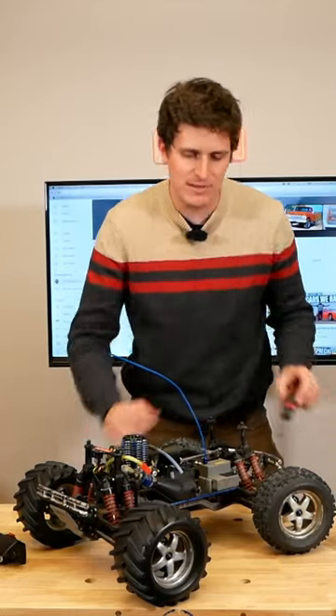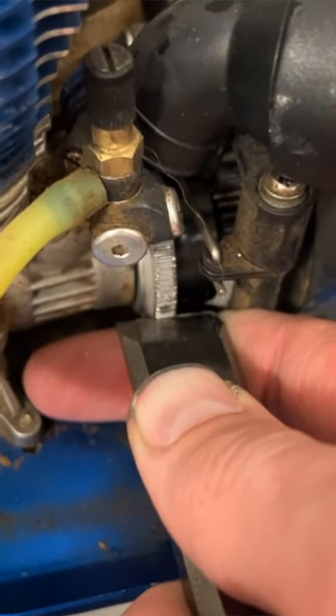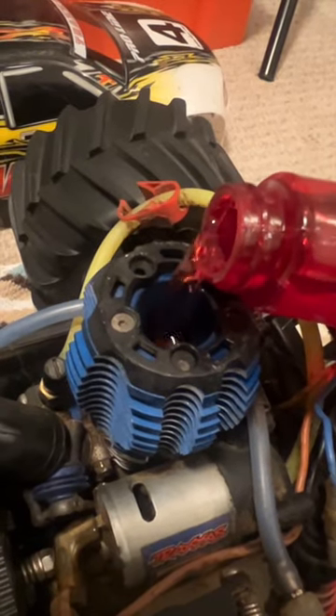It's a little bit sketchy, but basically you take a screwdriver and you just pry on the flywheel. Then I was able to go in and really lubricate that crankshaft and get it nice and kind of free.